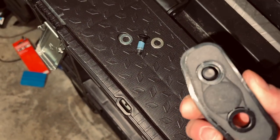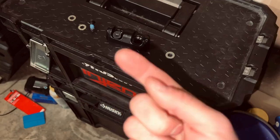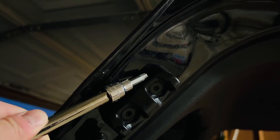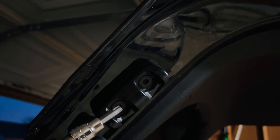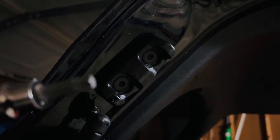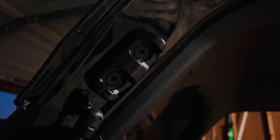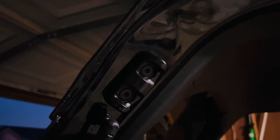So it comes out like this, and on the other side there are these washers - but look at the ones they provide, these things are so tiny. We are going to be putting on much thicker ones. I put the new washer in first, closest to the bolt, then the factory one back in to give it a little extra push. If that doesn't work I'll have to add two big washers. Regardless, we're adding the thickness of one washer over stock. Going on a test drive - if it works I'll link everything in the description.